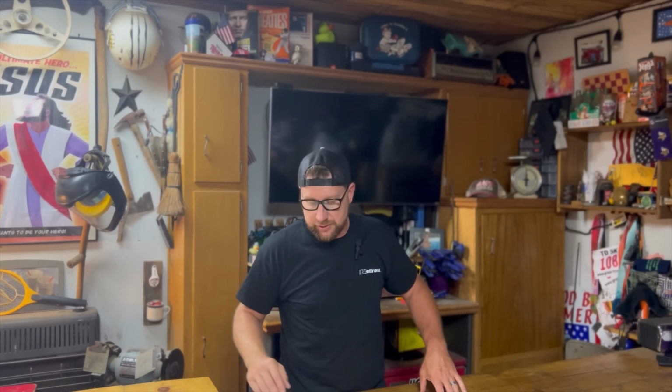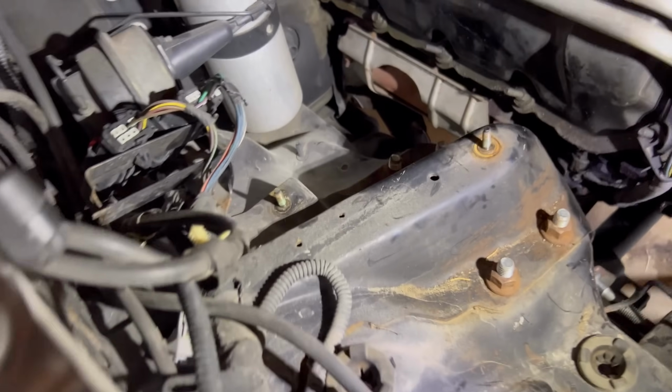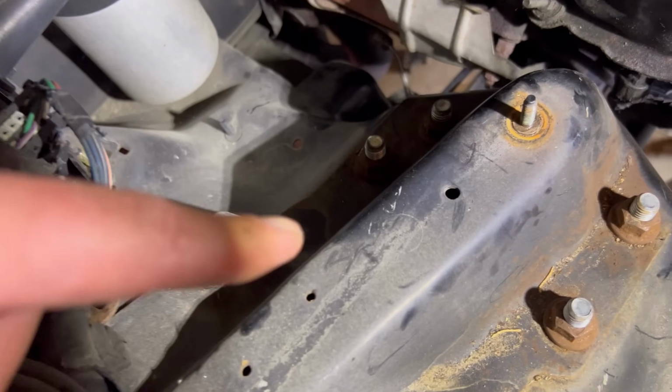Moving to the passenger side. This side should be a little bit easier, as we only have to remove the air cleaner and the air cleaner box and the cruise controller module out of the way to access the two bolts to the upper control arm. So we'll remove the air box, just 3 grommets, the box pops right off. Now we can access those two bolts.